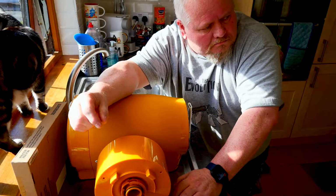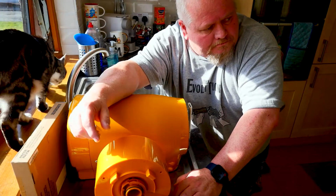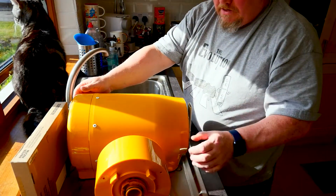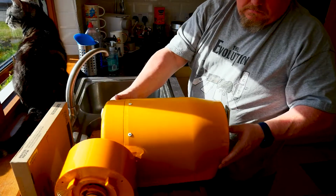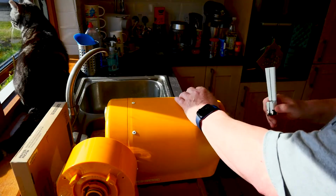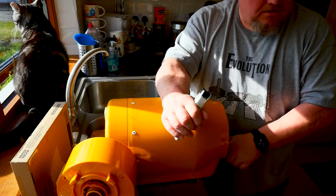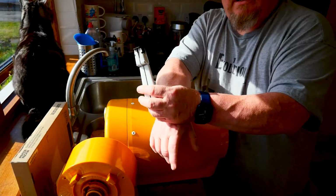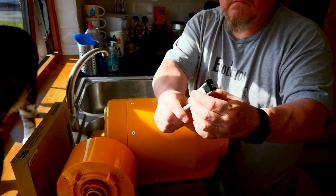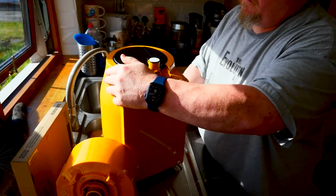Okay, purifying. Right, so it says, grip the handle by the base and slide it to the right. Handle? You know, the tap handle. The white bit. Oh, right, yeah. So basically take it off. Yeah. So handle removed, which is metal, it's not plastic. Okay. Lift out the front plate and store it with the tap handle for later.